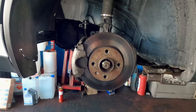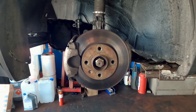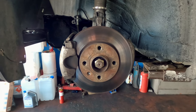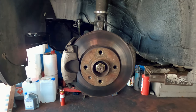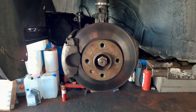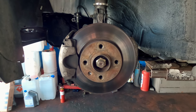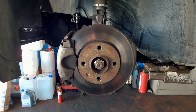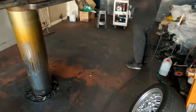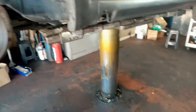So this is the brake setup on the car at the moment - it's 239mm - and it's definitely not doing the job. The plan is to do a Power brake disc and pad at this size, which should help. Then from there we'll go either 256mm or 288mm. I'm just concerned it's not going to clear on these wheels if I go for 288mm.